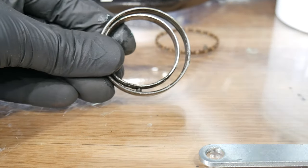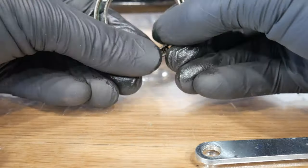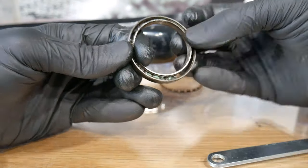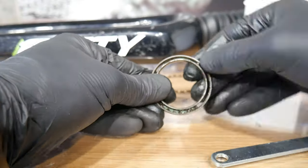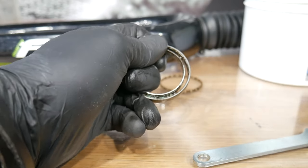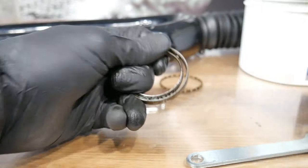You need to keep those two bearing races apart, as I'm doing, so there will be space for the balls to come in. The more balls are already in place, the less additional space between those bearing races there will be. I'm using a pick now to put all those balls on one side so that on the other side there is just a little bit more distance between the two bearing races, and the last three or four I needed to push into place with the pliers.